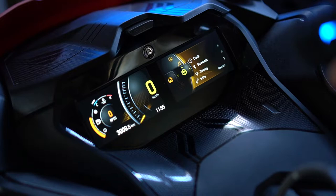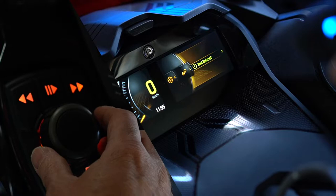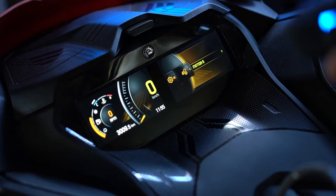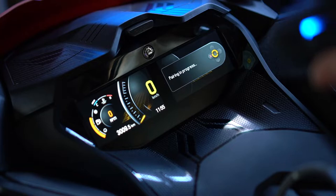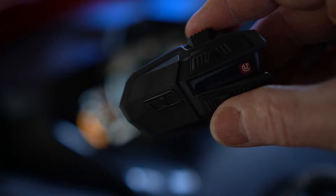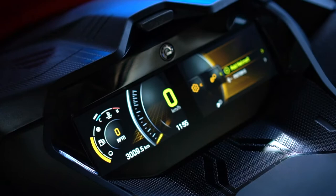Now go to the dash of the snowmobile. Press down on the joystick, go to Bluetooth, move the joystick to the right, and select Connect Rider Helmet. You can see phone, Rider Helmet, and Passenger Helmet options. Select Rider Helmet, then Add Helmet by moving the joystick to the right again. It says please make your device discoverable — we are — so move the joystick right to confirm. U-Clear Motion 6 pops up instantly and starts pairing. It flashes blue, meaning the connection is successful. We are now connected and can stream music or take phone calls on the snowmobile.